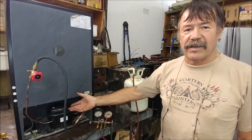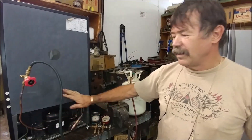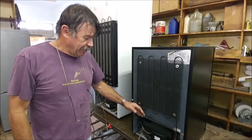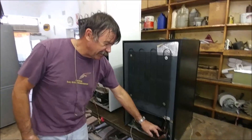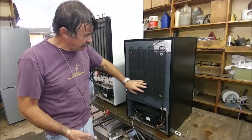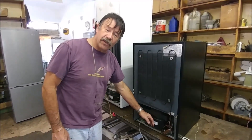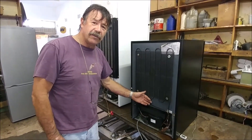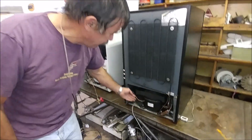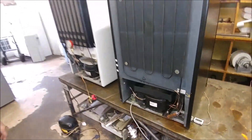That's how you change a compressor on a mini bar fridge. Once we're done we'll pinch this pipe off and weld it closed and send it out. This is a little fridge we changed the compressor on yesterday, but after it ran for a while this compressor overheated and this dryer was getting hot as well — as if there wasn't enough condenser. We added this extra piece of condenser on. We often find on the R600 system that if you convert it to R12, R12 needs more condenser to condense than R600, so we just added this extra bit on. Now the dryer is nice and cool and it's running. When we're done we just pinch it off and we're ready to send it out.